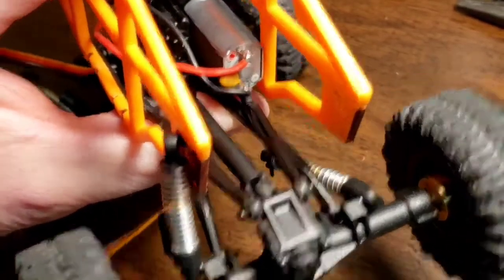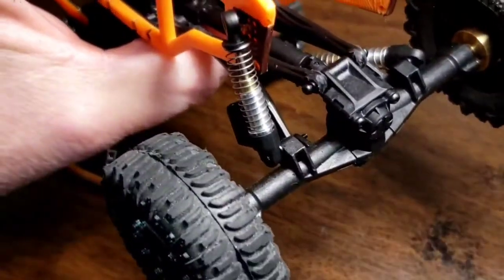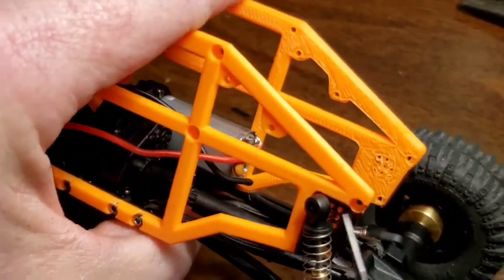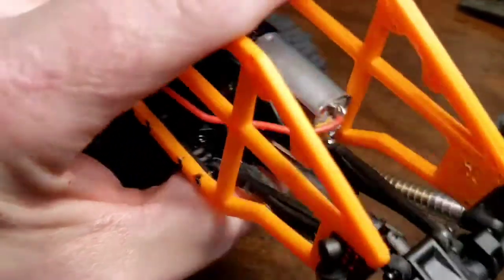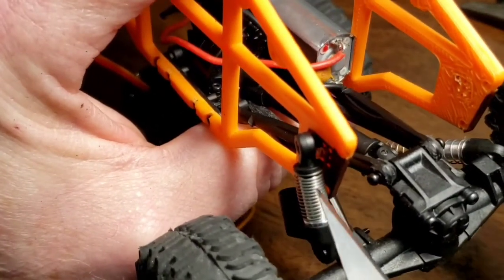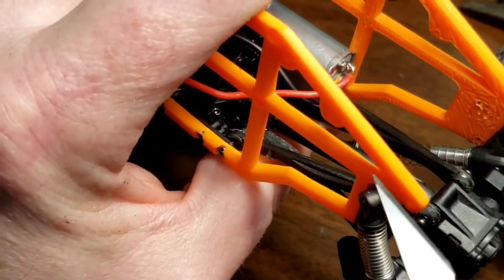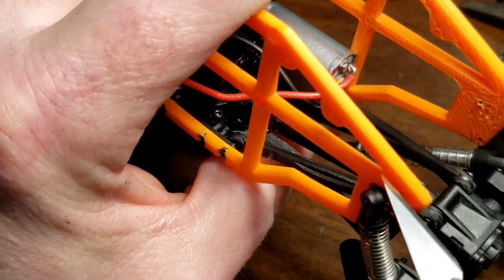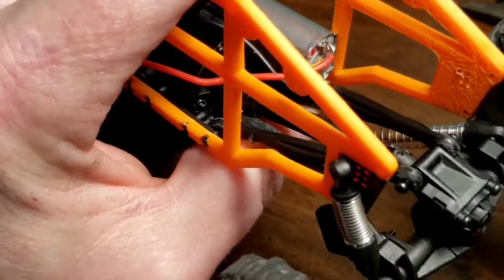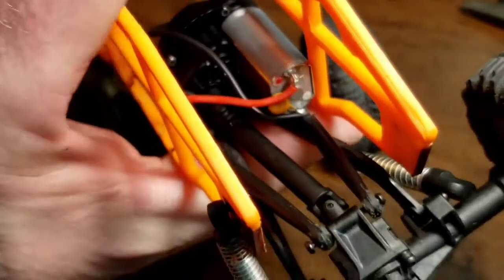I had a comment on YouTube asking if I would ever build a belly dragger, and one of the things that's cool about this particular chassis is you have multiple points for attaching the shocks. Full shock compression is one thing that limits the belly drag capability. If necessary, I could even mount the shocks higher on one of these bars if I wanted to lower the CG even more. But beyond that, you can only lower it so far because